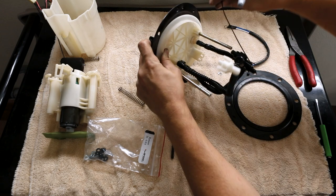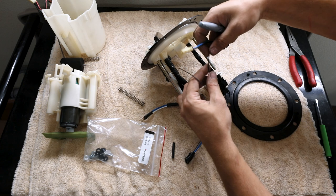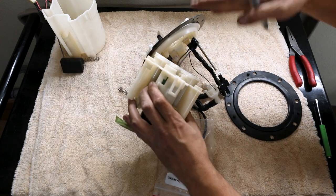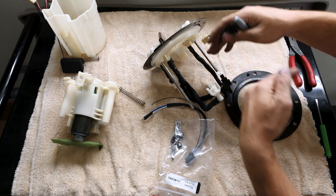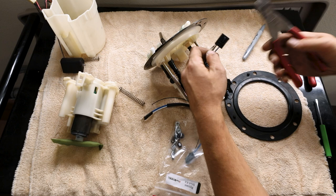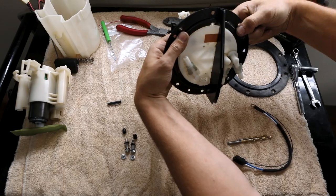For this guy, you are going to keep this ground wire. They already include a ground wire. So you're gonna clip this. You wanna leave a lot of it because this telescopes and it has that kind of spring to it as it's all together. So you need to make sure that that is there for the cord to be able to spring as this moves up and down. So I'm gonna leave as much of this as possible. So we're just gonna cut it right there. This is not going to be used anymore. So we're going to go right here